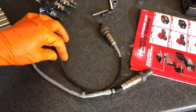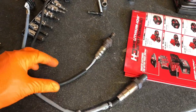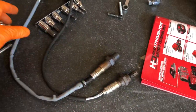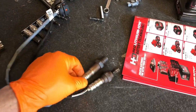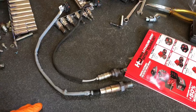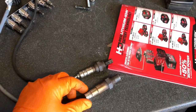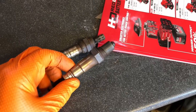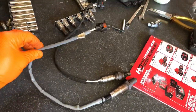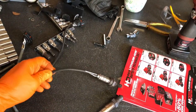On to the front lambda sensor. This car had a lambda sensor on there - a four wire narrow band lambda sensor that's a pattern part. You can see the difference between that and a proper brand new GM one that I bought about two months ago. The fuel trim is so important on these cars to sort the mapping out. If you don't have a proper lambda sensor giving proper readings, it's going to start pulling loads of fuel out as I showed in a previous video. Always replace the front lambda sensor with a GM one - NevLock does them brand new, get them from his store. Don't be tempted to go to Euro Car Parts and buy cheap universal ones.